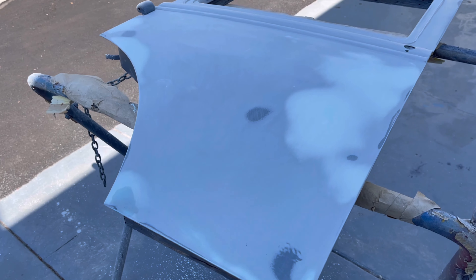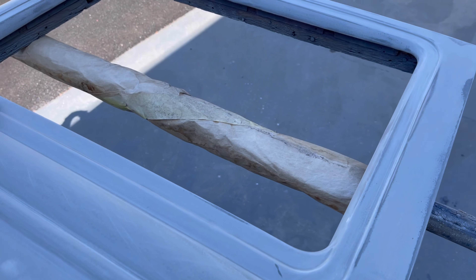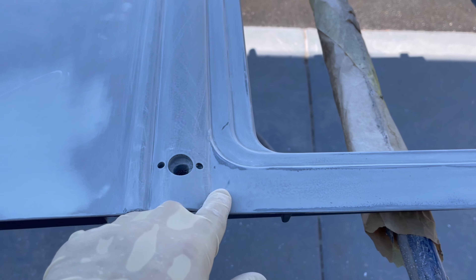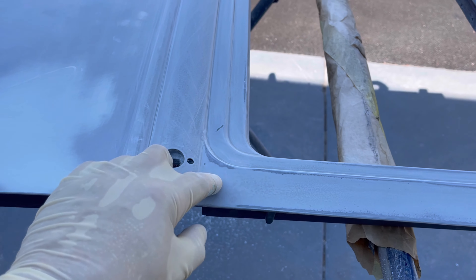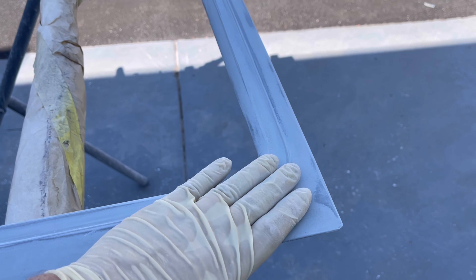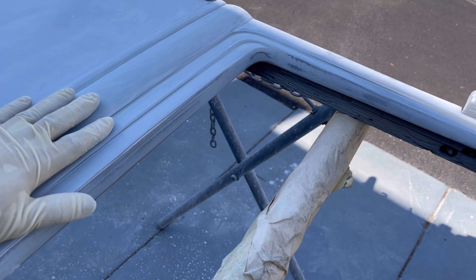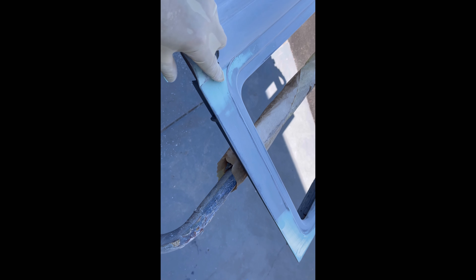Here we are with the panel fully blocked and the putty applied — nice and smooth through here. I decided to also go along and do the belt line, and I'm glad I did because I found some imperfections. There's a high spot here where it looks like a push from the other side, and a little high spot here. These will not get covered up with putty no matter how much you work them, so I'm gonna have to tap them down lightly — careful not to distort the metal — and then put a little glaze over it.